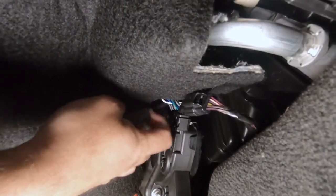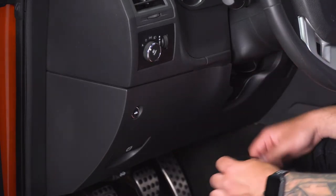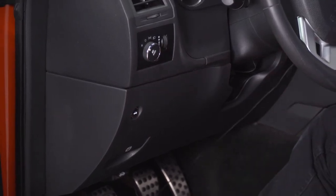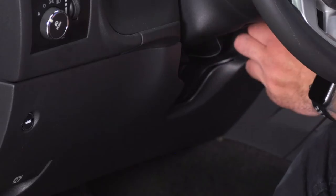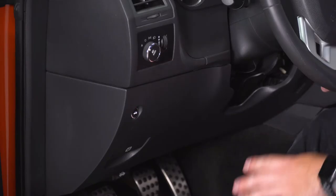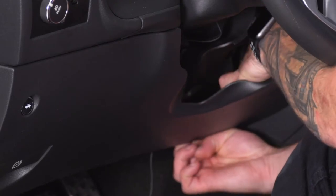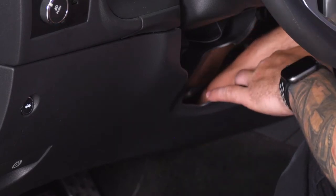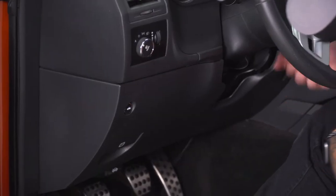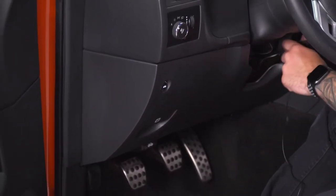Now take the little block included in the kit and plug it into the other end. Next step, we're going to feed that cable up through the trim under the steering column. It's not completely required — you can just pull it straight up and tape it back — but if you want a clean look, go to the right here. This panel pops right off; you don't even have to pull it completely off, just enough to create a gap. Take that cord, stick it up through the bottom, put your hand through the top, and pull it through. Make sure none of the cable is dangling over the pedals, which can be pretty dangerous.